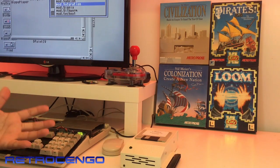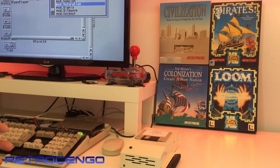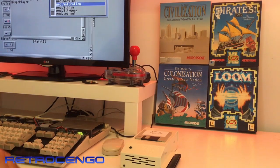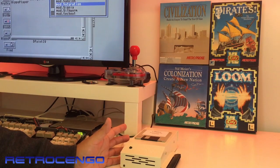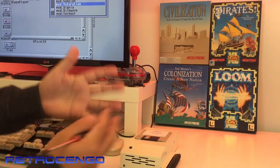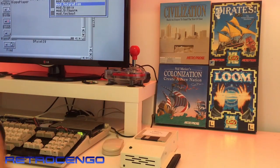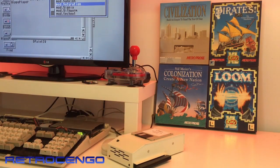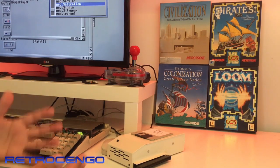After Individual Computers' Jens presented us with the ACA 500, all of these older sidecar expansions just got obsolete for me the same day — but I still think they're magical. Probably for nostalgic reasons, because with the ACA 500 Plus you can have a 30–40 MHz accelerator, 2 to 8 megabytes of RAM, compact flash solutions. These older expansions from back then just have a special place in my heart.